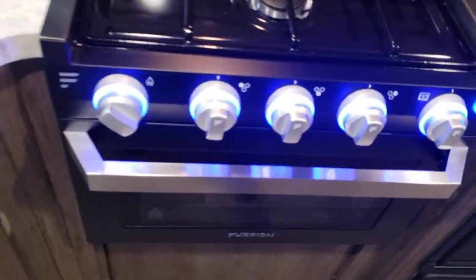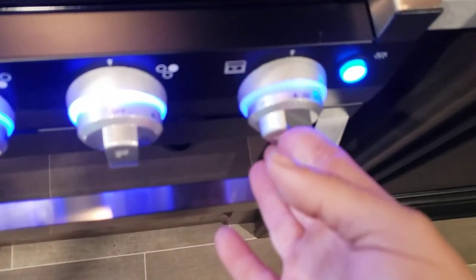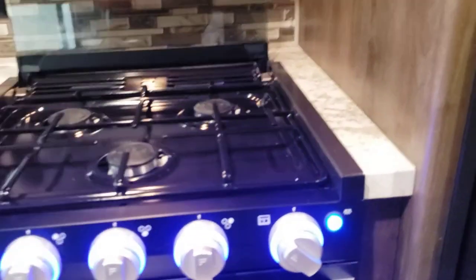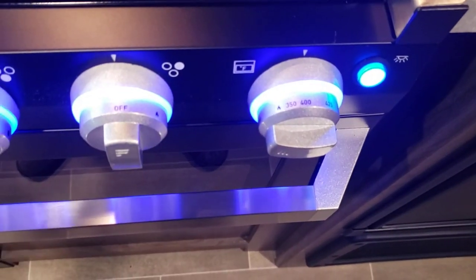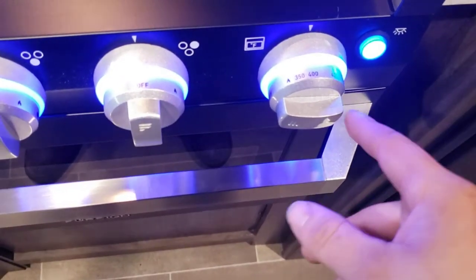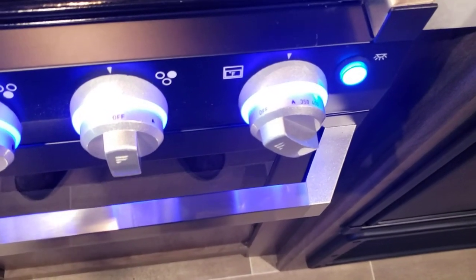There's a little light here that turns a decorative light on, which also turns the oven light on. To light your oven it's a little bit different — turn it to the flame, push and hold, and you can see the light dim a little bit. As you're pushing and holding, you turn the sparker because there's a pilot in there you're trying to light. Once you get that pilot lit, you can turn it to whatever temperature you're cooking at. Once it's reached that temperature, it'll turn off and cycle the burner on and off. If you plan on cooking again in a few hours, you can turn it to the flame — that shuts the burner off but leaves your pilot on so you don't have to relight it. I recommend turning it off before you go to bed; you don't want a lit pilot overnight.